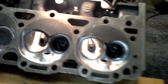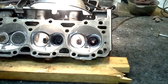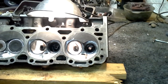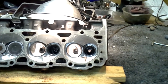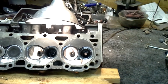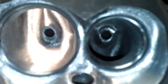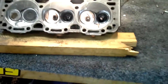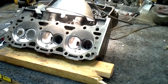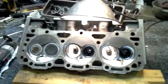I was tempted to remove the guide tails entirely — I've seen other Vortec heads where porters just take the tail completely off the guide. A lot of head porters don't use guide tails at all. But I don't think it's really going to be worth it on this one. If it had aftermarket guides I could cut the guide tail out and just have the guide sticking up in the port, which would be optimum. But this thing still has good factory guides that haven't been replaced, so I'm going to keep those guide tails on there. If he goes through these heads at a later date, we can look at more radical changes — maybe even go to a bigger valve to get more flow out of them.